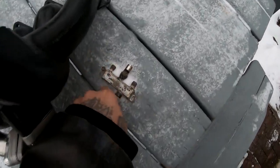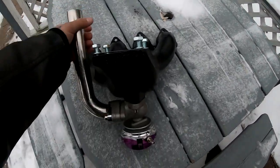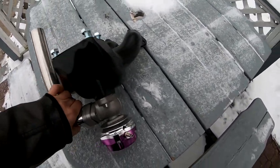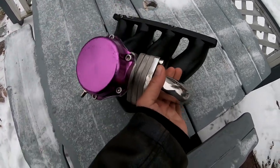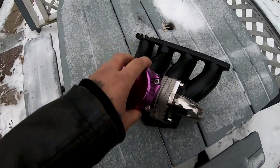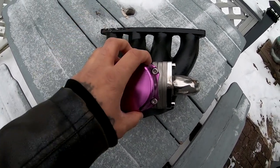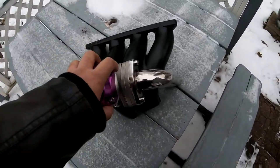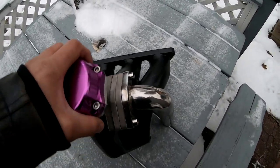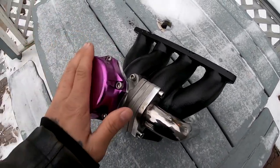Don't mind this, it's just frozen on here. All right, so the first thing I'm gonna do is flip this guy upside down and pull this cap off and put the smallest, softest spring back in there. We don't want to boost up right away — we want to break this engine in after everything's together, so that's the reason for that.